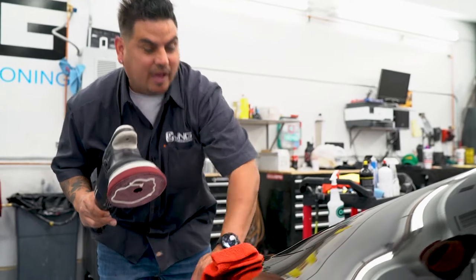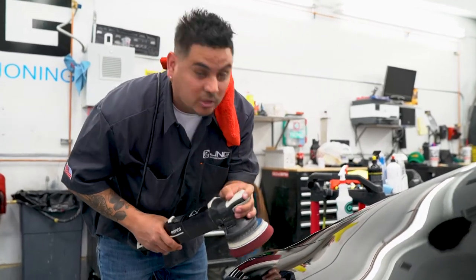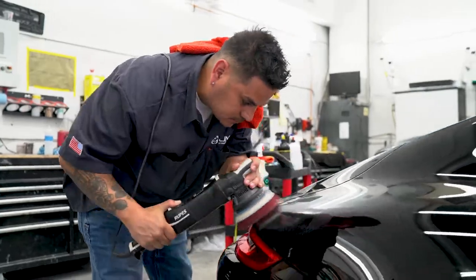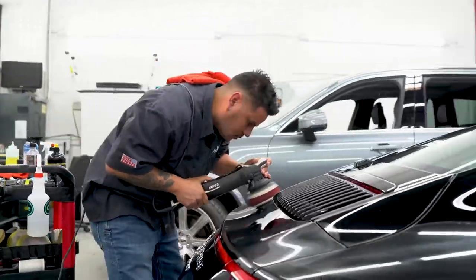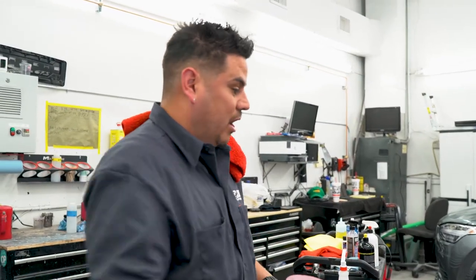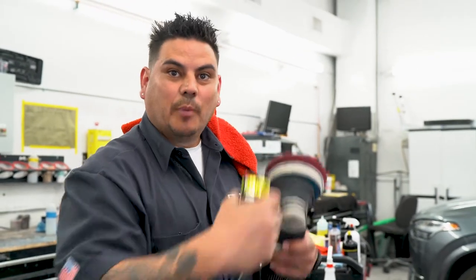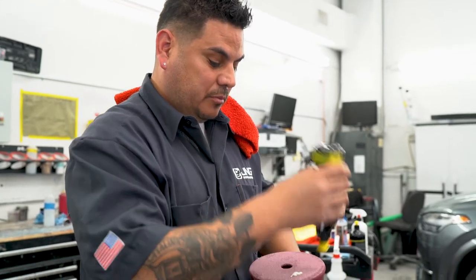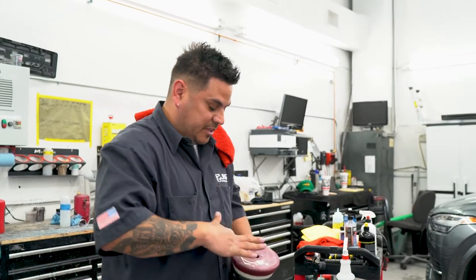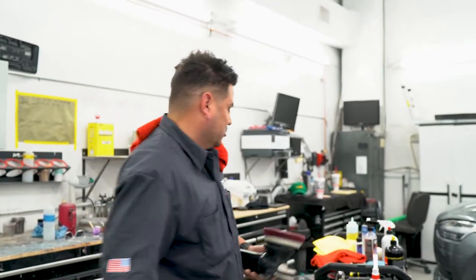Keep it as flat as you can. If you have a mini polisher, use that for easier access, but I'm really comfortable with this tool so I'll use this one. That's just a prime pass — I've got the compound on the actual panel. This is a bigger area; most people would want to do a two-by-two crosshatch pattern, but we're going to do the faster way. With a new pad, you want it fully covered, so I'm adding a lot more compound to make sure it's deep in there.